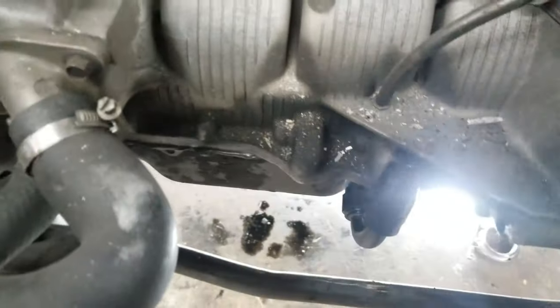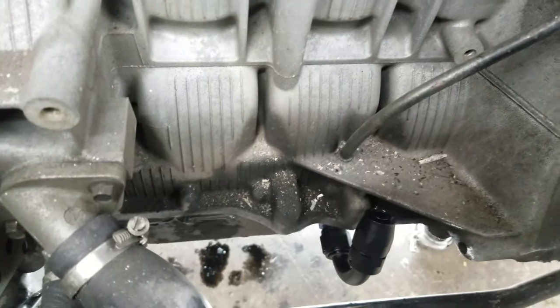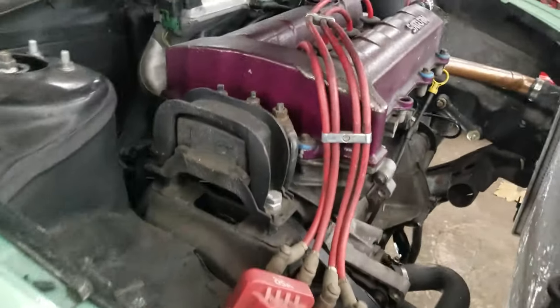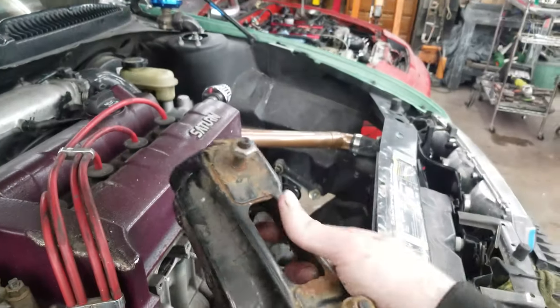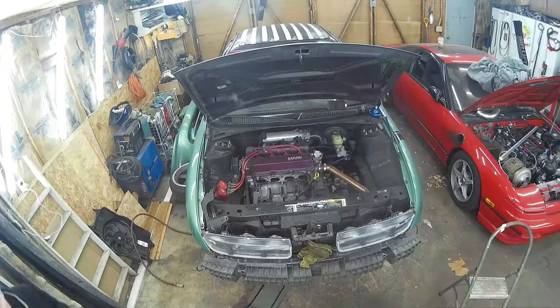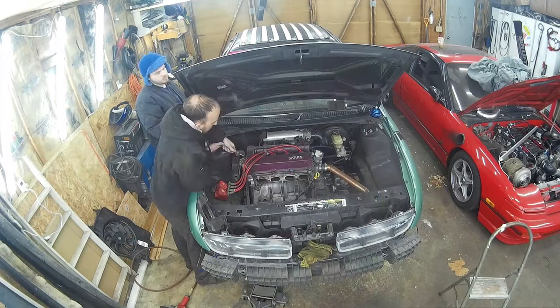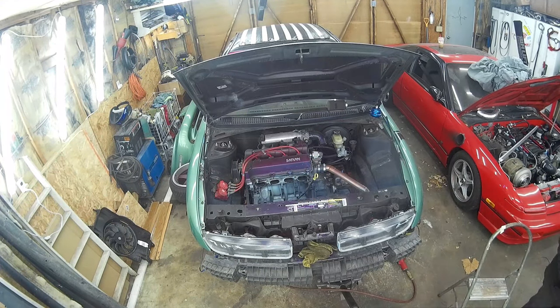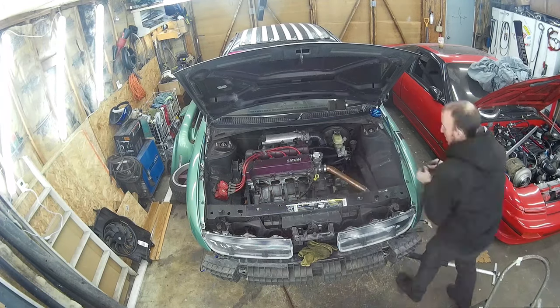Got the oil pan up and it's in the car now. Now I have a fitting for the drain on the turbo. Just got the crank pulley and everything back together, serpentine belt back on. Next thing to do is swap out for the stock transmission mount and drop the motor back down to factory height - hopefully that means the turbo will sit under the hood. I'll check in after I get the manifold back on.